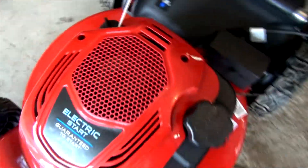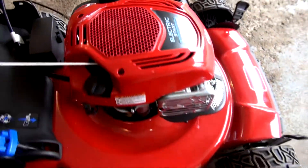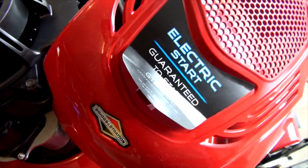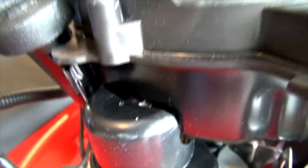I'm going to see where the gears are meshing in the starter to find out what's going on, then take the starter out if I have to. I already told them I'm returning it for my money back if I can't fix it, but I want to try. I took the top cover off — there's a clip. You have to move the label back a little, push with your finger and get it out. Here's the starter motor and how it engages with the flywheel.